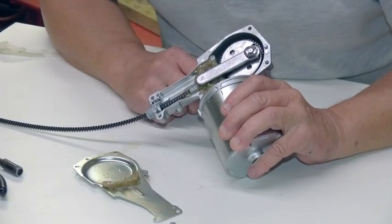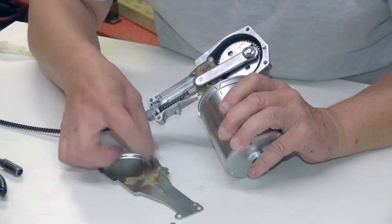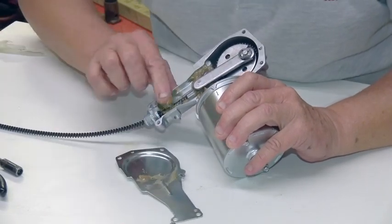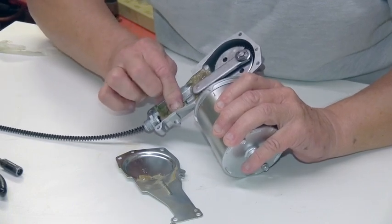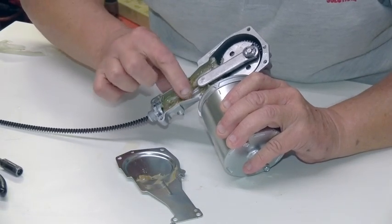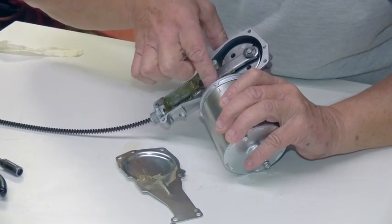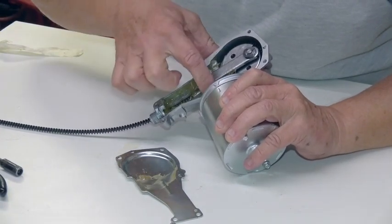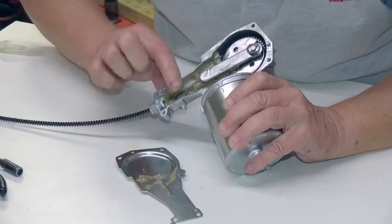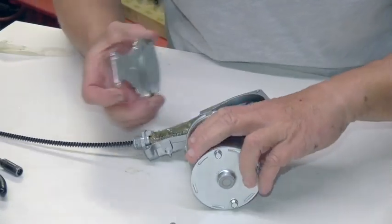Now we come to fitting the cover back on, but first let's use a little bit of the grease that's in the cover and just spread it in the nylon channel around the cable. Feed it all the way around the cable — you can spread some down there, use your finger to push it in so it goes down into the nose. Put a little bit back around the gear. You've already got some on the park switch, so just spread the grease in there.